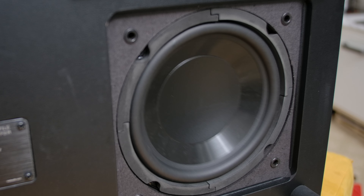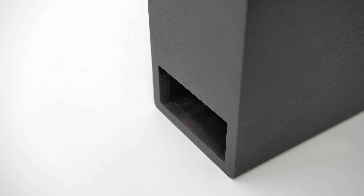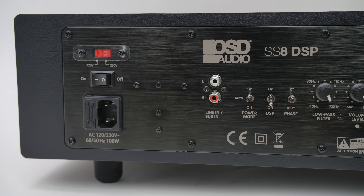What are some of the downsides? Like I said, it can't play those super low frequencies at high SPLs — it just will not play them. Even if you tune the DSP to extend it further, you're going to reach the limits of the amplifier and driver. When you start trying to push it, you're going to hear some noises you don't want to hear, and you'll start noticing resonance at certain levels. It doesn't seem like they have a limiter on here, so you can overdrive it — if you start hearing crazy noises, just turn it down. On my particular unit there was an air leak near the power plug. They said they're going to address that in future releases, but a little bit of blue tack or hot glue will solve it. At this price it's almost forgivable.